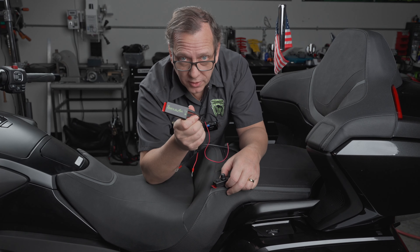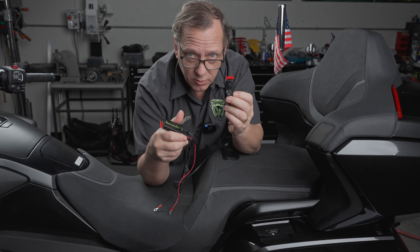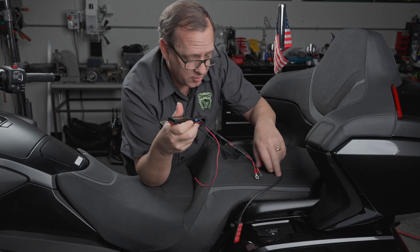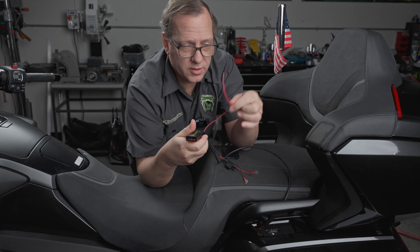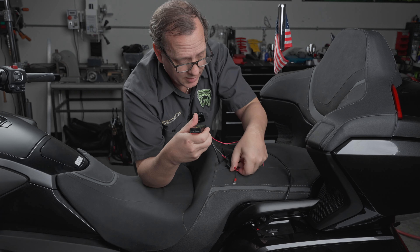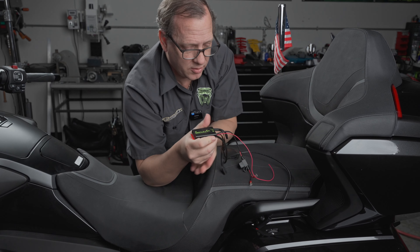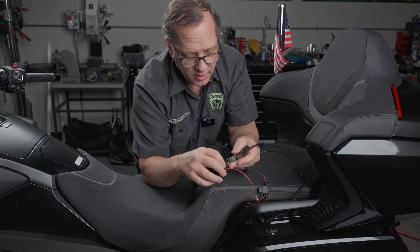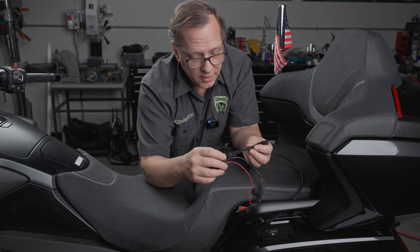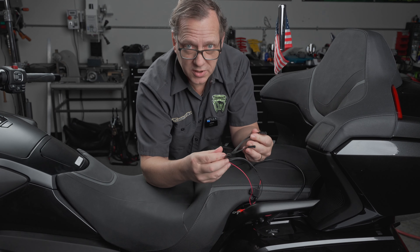This is the Shock and Awe 2.0 controller. It has a whole bunch of wires coming off — let me show you what these are. Number one, this is your manual control; it's going to end up down here on the saddle bag so you can control it without using the Bluetooth. You also have this little red dead-end wire — this goes to your brake, and I'll show you what that does later. This is your power and ground and it's fused. We're going to run these to the battery first, and then these are your three leads that go to the lights. There are three different channels; each channel can be operated all together or individually. There's channel one, two, and three — you can tell which is which by length. The longest one is three, the shortest is number one.